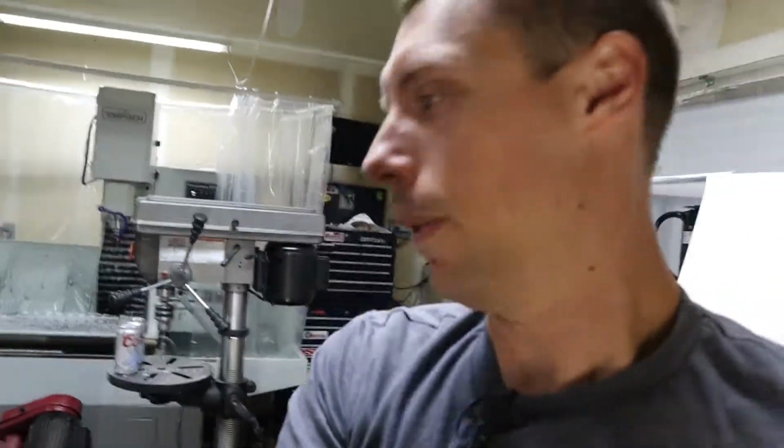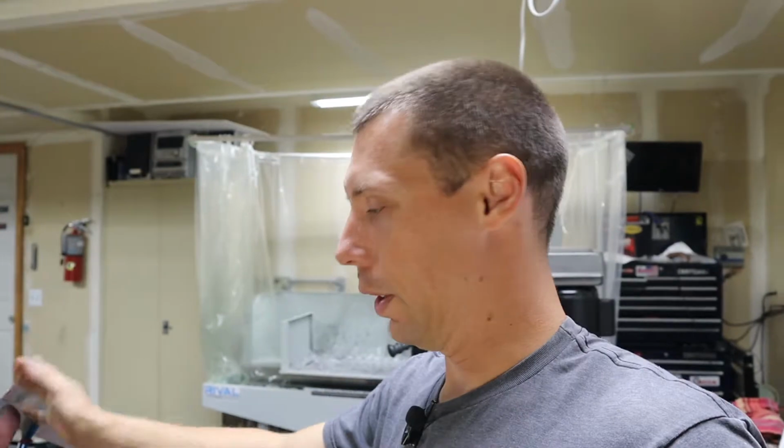Little bit of background info on this one. Just got this cart, only taken it out once. One of the things I noticed, and let me caveat it with, I'm not a very good thorough inspector when I'm buying something. I get excited and I go for it. So I didn't notice that the clutch isn't releasing all the way, or it's not disengaging, engaging, I don't know. Depends on how you look at it, right? Bottom line is when I push the clutch in, the wheels are still grabbing.